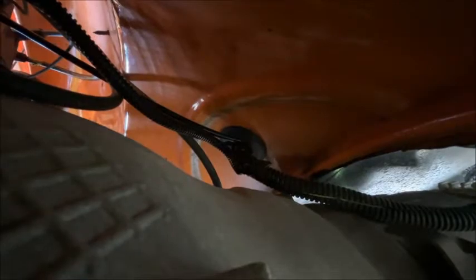All those wires feed into the cab. Be careful with the connector that goes on the back of the transmission — it's a fairly large connector through a one-and-three-quarters inch grommet hole, and you can get it 180 degrees out. It's supposed to point toward the back of the transmission, which seems odd, but that's where it goes. The throttle position sensor cable also routes through that same hole into the cab.